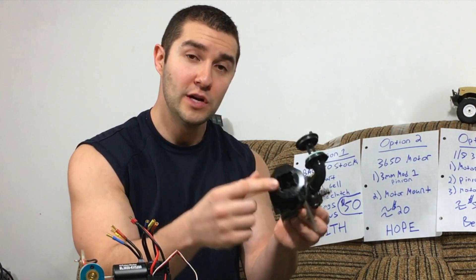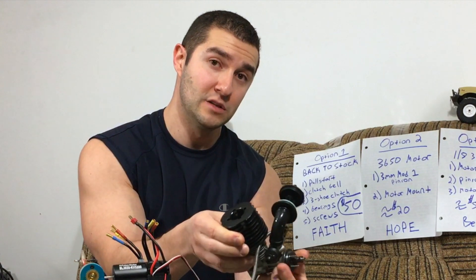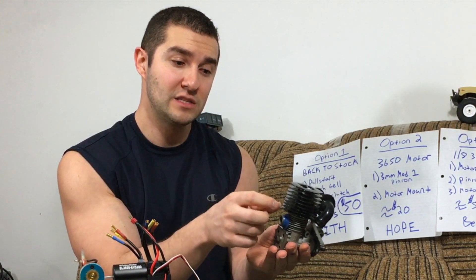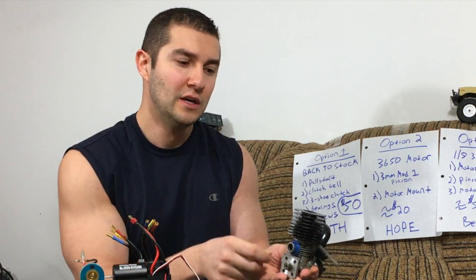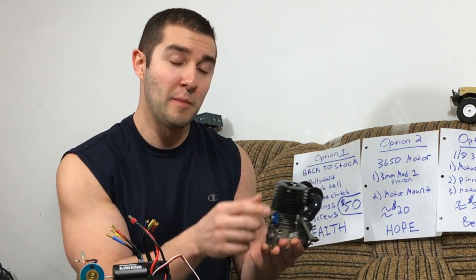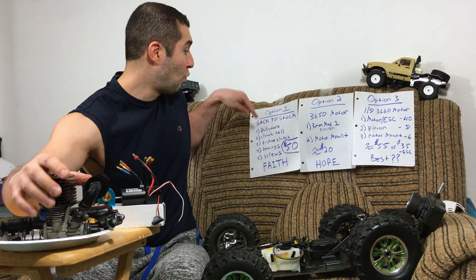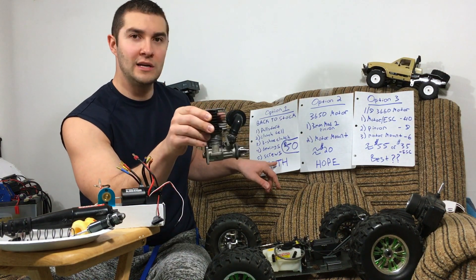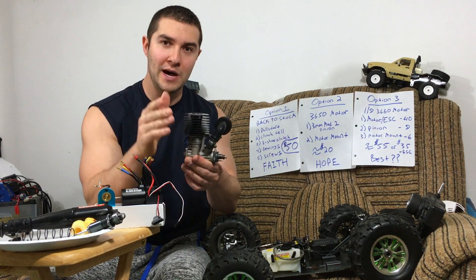So I assembled the motor back up. There is no glow plug in here, but if I spin the flywheel there's a good amount of compression — like I'm having a hard time spinning this. Just so you guys know, these larger motors still have a lot of compression at top dead center. The piston and the sleeve are fairly tight at the top, and oftentimes the pull start will just rip when a user is starting it kind of erratically, especially if it's flooded. I've ripped pull starts like that before on 0.21 and larger engines — that is probably what happened here. I remember on my Hyper 8 port, I had to put in a metal pull start. So that's what we used to do back in the day. This is option one — back to stock, make this engine run again, hopefully if it even works. At the bottom I put that I need faith — I honestly need faith, hope, prayer, wishes, dreams, popcorn — it doesn't matter. I need a lot of that to make this work.